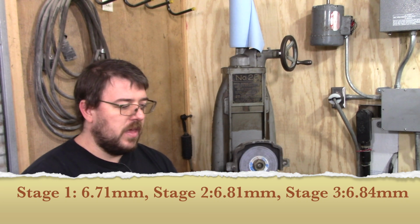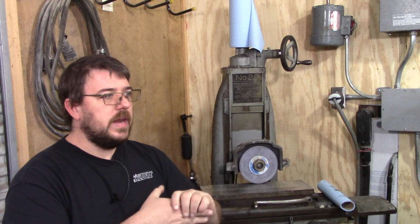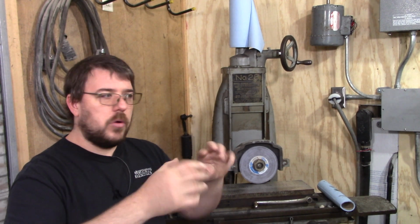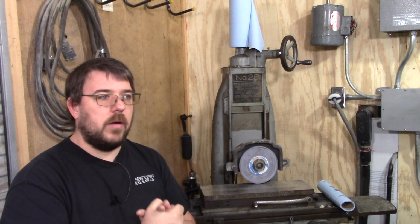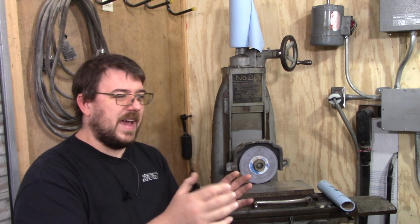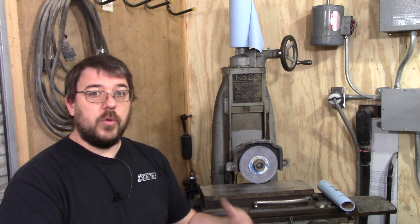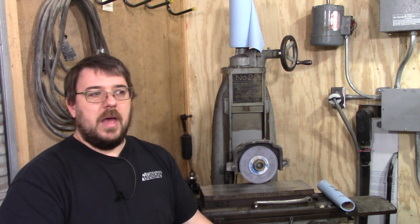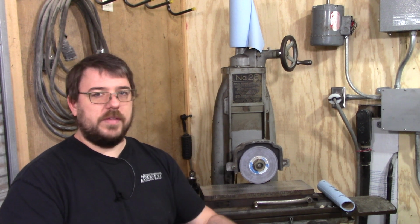Because really, from the inaccuracies on the centerline that I'm seeing, even if I imbalance the air to fuel ratio along with the centerline difference and get the motor in the worst possible condition that I can get it in, where the stock ECU would do, where you don't have the aftermarket ECU to be able to correct it, I really can't get the cams to lose much more than about 20 horsepower. Now, 20 horsepower is still very significant, and I think that should be a cause for concern. I'm not really liking the inaccuracies on the centerline that we found, but I don't think that's the whole thing.